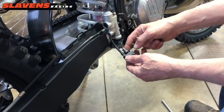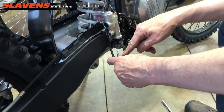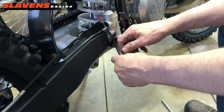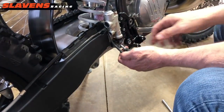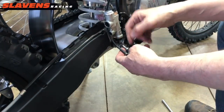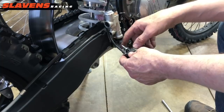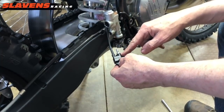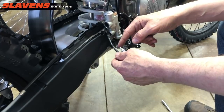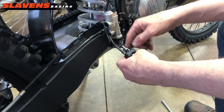So it's a real simple adjustment. Then when you want to lock this nut down, you can't just turn on it because it will just rotate. You can pull up on this a little, or squeeze the lever just a little bit. But be careful — do not squeeze that lever until you get this thing fully mounted. If you do, this piston assembly in here will shoot out like a rocket, and then you'll have to bleed the system, which defeats the whole purpose of buying a sealed bled system.